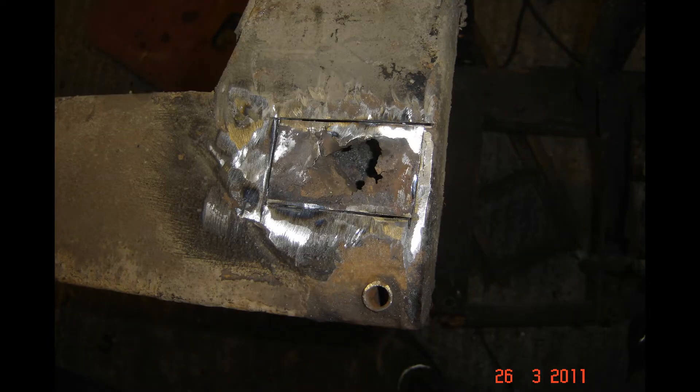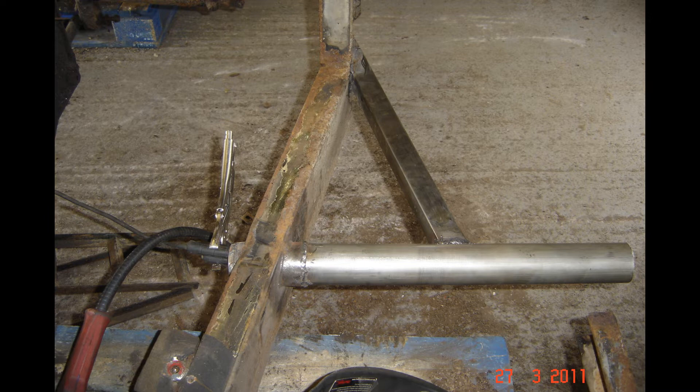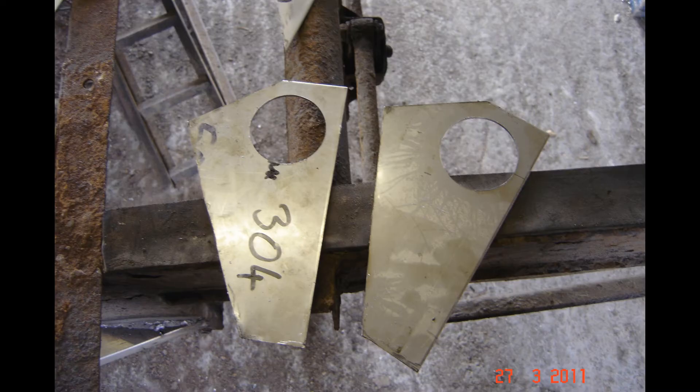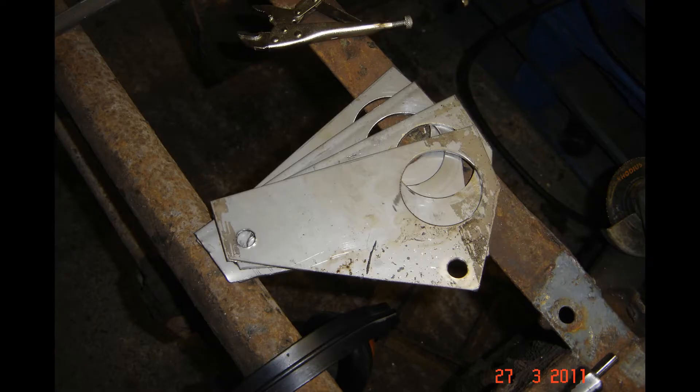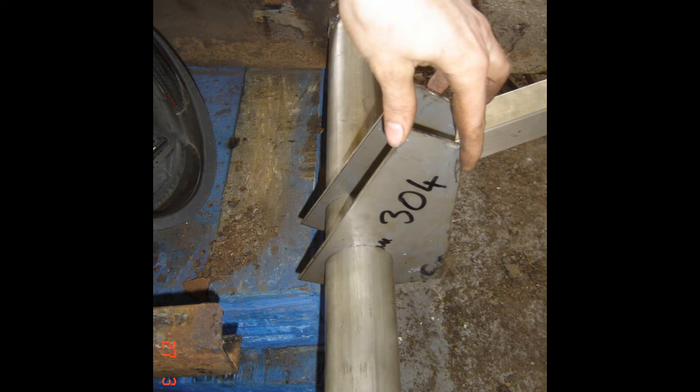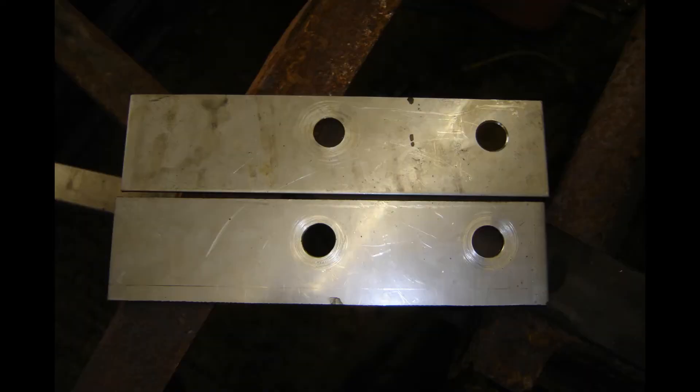After that there was a little repair to do in the back corner. You can see I've welded in another piece of stainless which triangulates that tube, and I've done both sides — welded the tube into the old tube inside and outside. These are the mounting plates; I chopped out and made four of them to each side, put the bolt holes through. These hold the four-link rear end, and these are the end plates which attach to the actual outrigger rail.